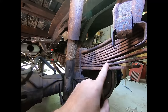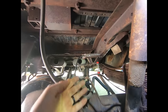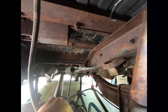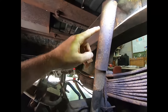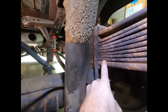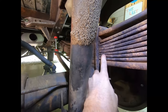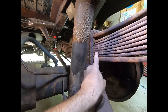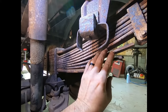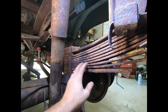If you look at the leaf spring - pretty rusty. Now overall this truck's not all that bad really. It's rust colored but everything's still structurally sound. Chassis looks really good. It does need a set of shocks. We've got a broken leaf spring here and a broken leaf spring here. We've got what looks like a starting crack there, and that's not a huge deal really because these run out into nothing. They're just load bearing springs and if those broke off it really wouldn't cause you to run off the road.